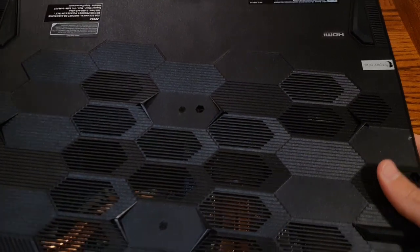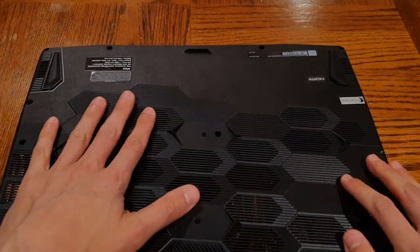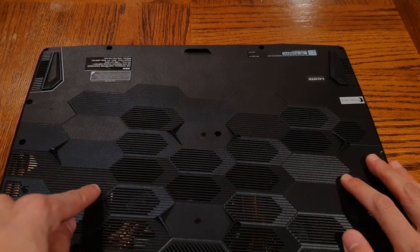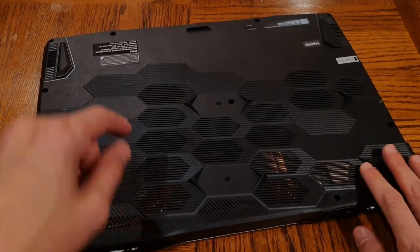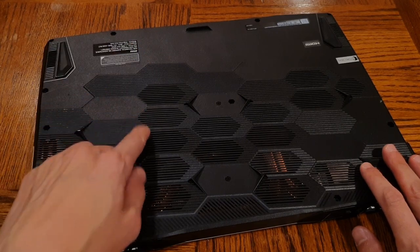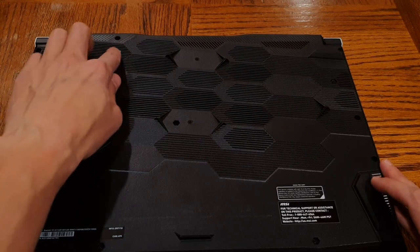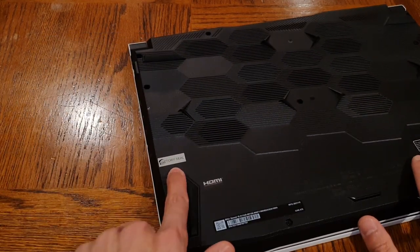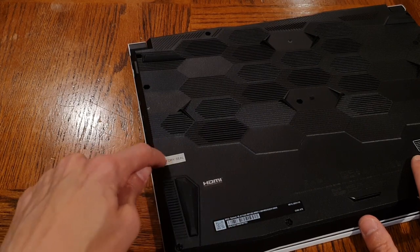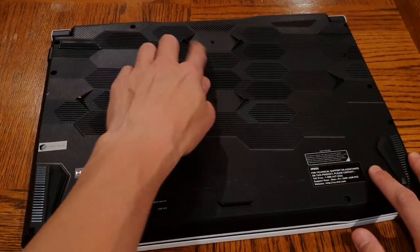The other thing we're going to do is take off this back panel and look at the RAM situation. Right now the basic configuration is only 8 gigabytes — I want to bump it up to 16. So we're going to swing this guy around. There's a whole bunch of little screws all over the place. The one you've got to watch out for is the one that already says 'factory seal' — you just punch through that and make sure you unscrew it. It's all standard Phillips-head stuff.